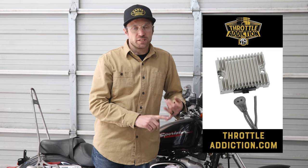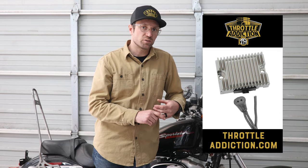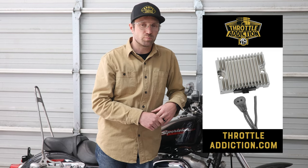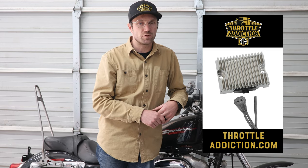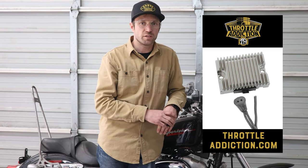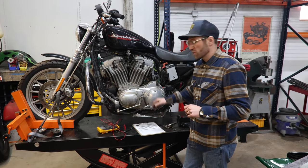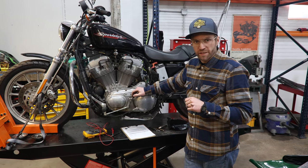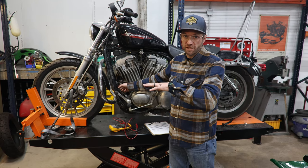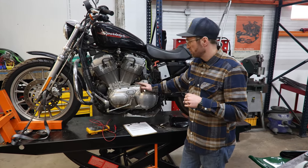So if you pass the battery section, pass the stator/rotor section, the last portion is the regulator rectifier. If you failed anything in that section, we are condemning that regulator rectifier. That's really the one you're hoping for — it's cheaper, it's easier, and probably the most common fault you're going to see. Throttleaddiction.com — we've got black ones, chrome ones, all sorts of regulator rectifiers. Find the one that works for you and get it fixed. We ran through our numbers and everything passed, so our regulator rectifier was good. One thing that can happen is these can get hot and cause failure — usually if I know there's an issue and everything checks out cold, take a heat gun or blow dryer and heat that thing up while doing the test, and occasionally it'll show an internal issue.